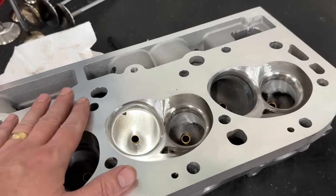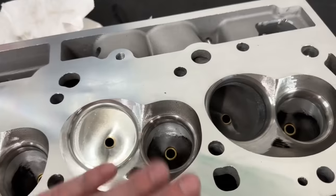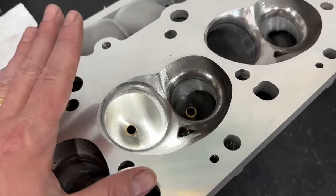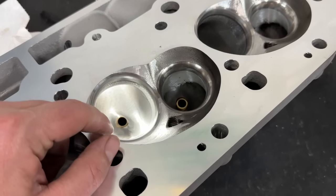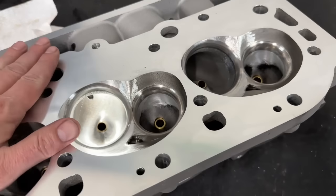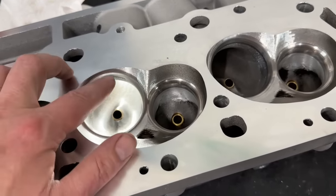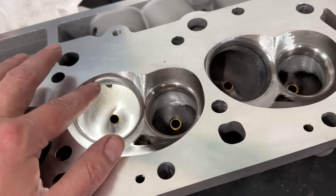Two things have now happened, and this being one of them. What I did with these 317s is I flat-milled them — not angle-milled, flat-milled — down to 110cc, so now they have the same chamber volume as the 290s. I also redid the valve job. There was so much milled off — about 54 thousandths — to get down to 110cc that it was actually getting into the valve seat itself, so the valve job had to be redone regardless.